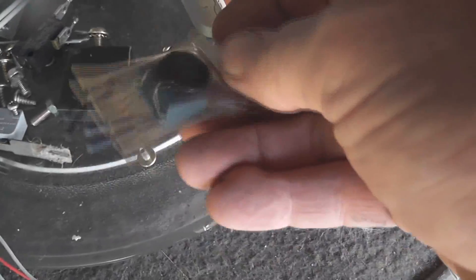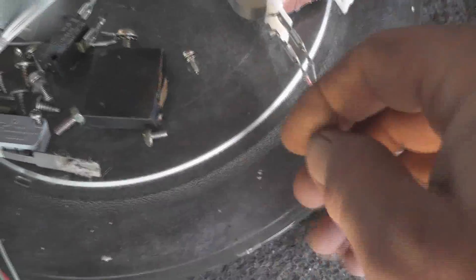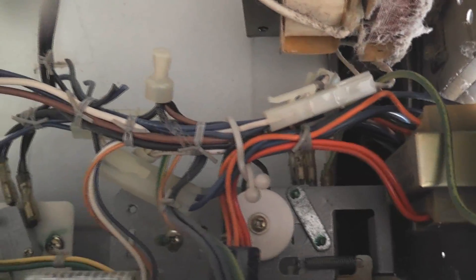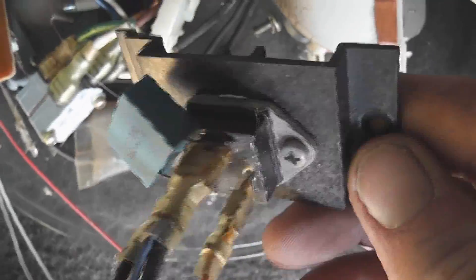Nice old technology — beautiful. I like the way this capacitor is put in a little casing with a plastic seal behind it. Really cool cooling fan. What's really noticeable on this older microwave is that the wiring is a lot thicker — heavier gauge wire, at least 0.5 to 1 mm compared with about 0.2 mm on newer microwaves. Classic cost-cutting.